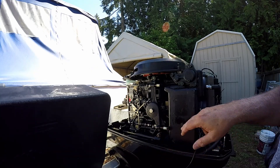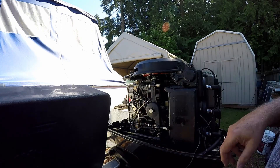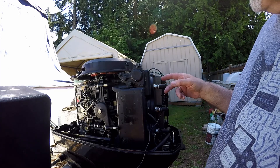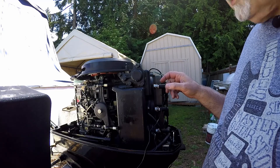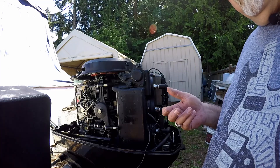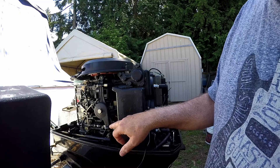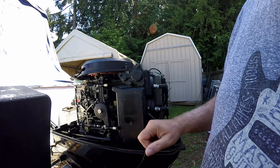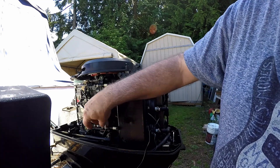First we want the idle set at 650 to 750. Right now it's a little low — it's at 600. I'm going to clean these spark plugs because they're still fouled because of the oil I put in there for storage. We're going to get those out, get them cleaned or replace them, test it again, and if the idle is still too low I'm going to have to set this screw up to get the idle higher. Once I do, tighten it down — it's set.